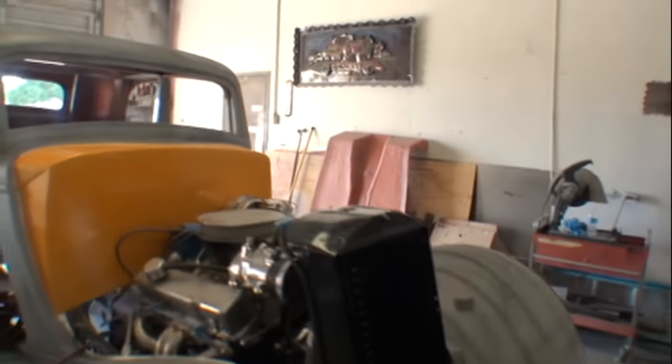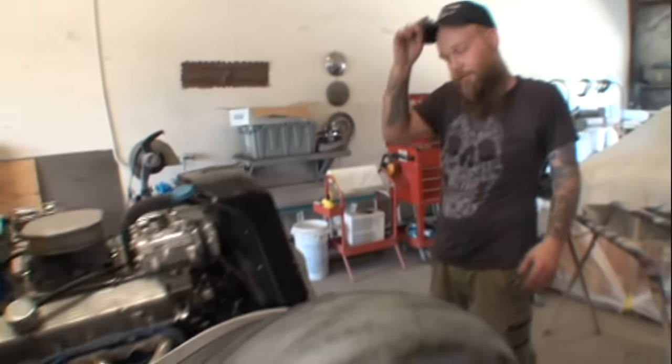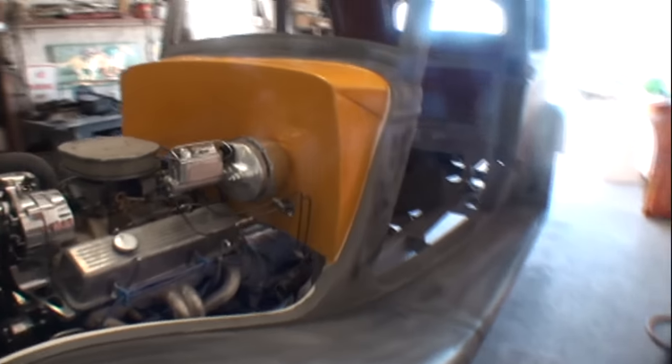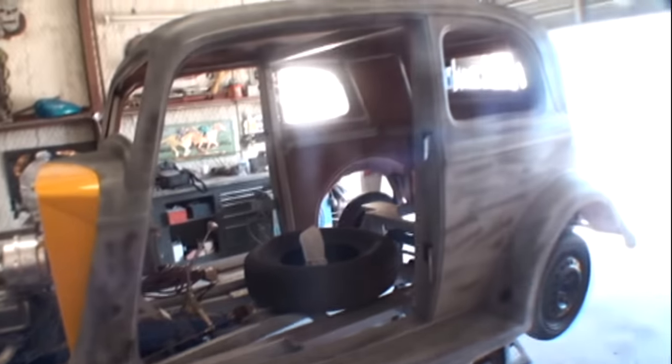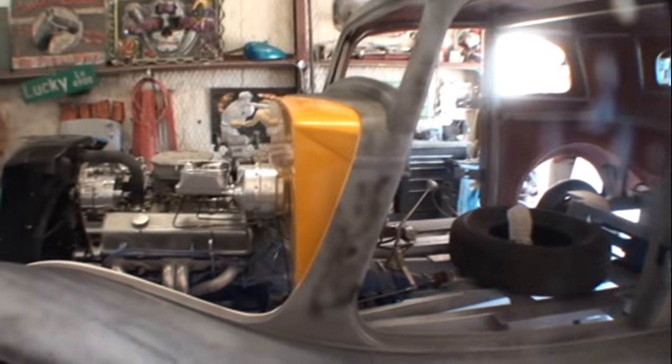What do you think so far about this, Will? Well, it's definitely turning into the fiasco that it could be. Dealing with getting the booster back on the firewall and getting it jacked up in the air to try to keep going. Looks real nice. An uphill battle, and it's getting higher as you see. The mountain has raised another two feet. That's a good saying, Will. We got the booster on, got the firewall painted, got the whole car block sanded down, got it all primered. Got the guide coat on it, and about to start knocking out some welding, huh?